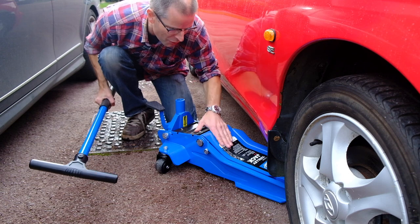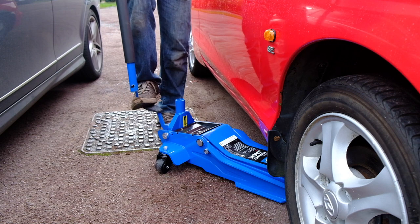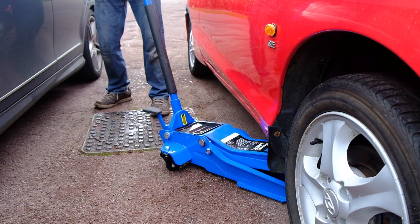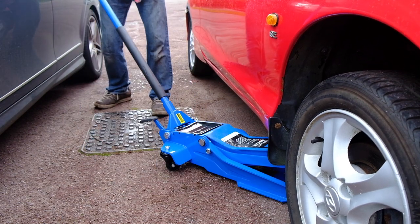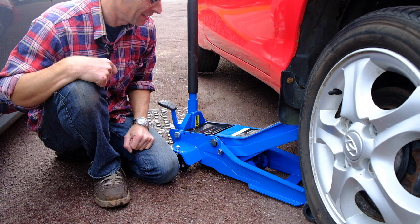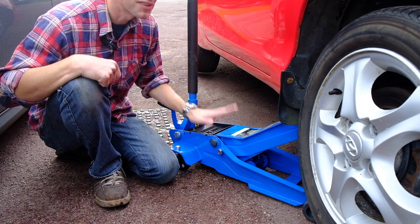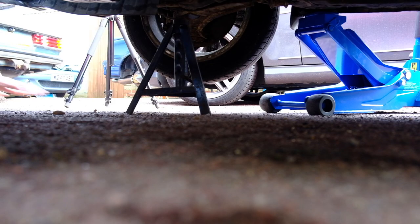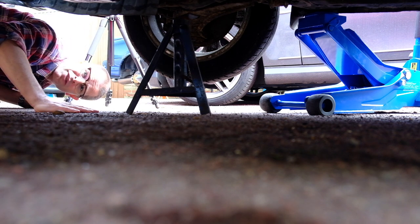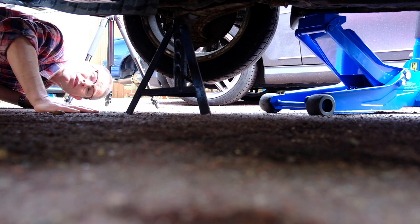I've got my rather lovely big heavy-duty jack which will make lifting this car no bother at all. I rather hope this is the jacking point as it looks like it is. This thing is epic — I'll find a link and put it in the description below, but this is making my life so much easier. Even though I've got the monster jack, I'm still putting an axle stand under it just in case, because even though the jack is probably solid, I've no idea how good the floor is.